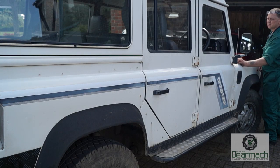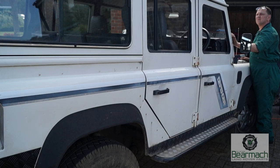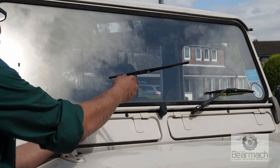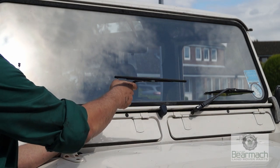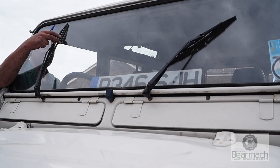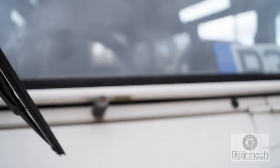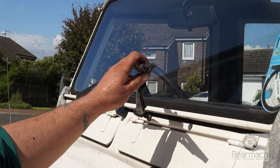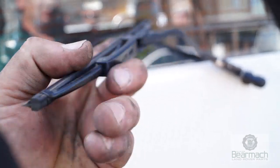Having a look around to make sure nothing's hanging off or sharp. Now looking at the windscreen — the rubber is not in very good condition. The window wipers are actually very important — both their condition and security. This one fell off in my hand. What I'm checking for is the rubber condition and the condition of the wiper blades themselves; they should wipe the screen easily. This one on the Defender is loose because the splines on the splined adapter are worn, rendering the wiper inoperable. Make sure the blades aren't split — that is also an MOT failure. The best thing is to renew them often.